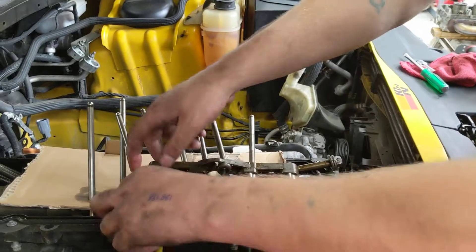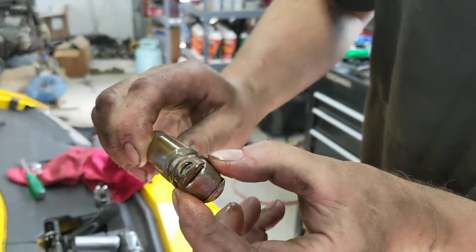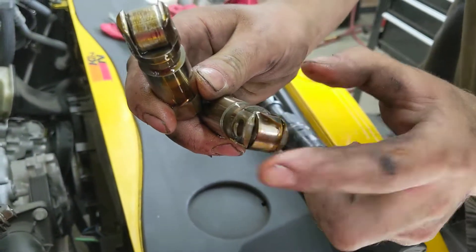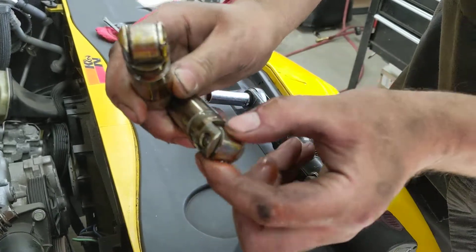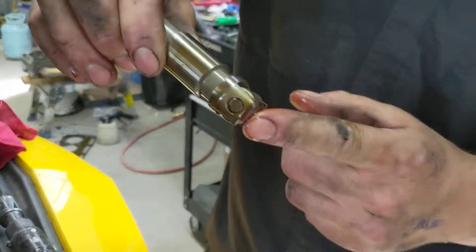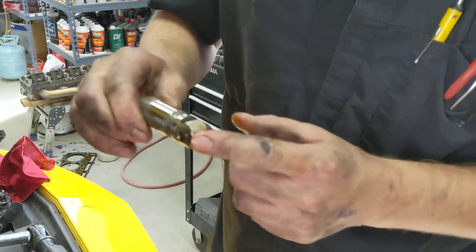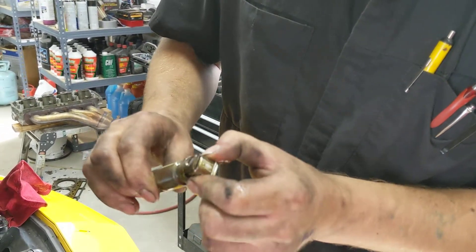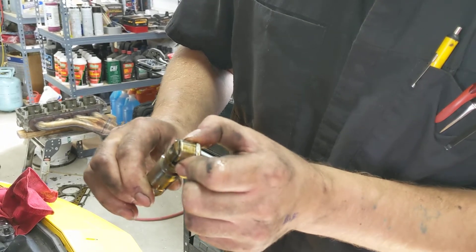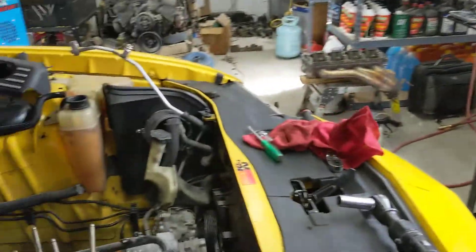Another good reason to do your oil changes sooner than later is these lifters — as you can see, this roller on this lifter is completely seized. This guy rolls; that bearing moves nice and smoothly in there, got oil to lubricate it. And then you got this guy completely locked solid. What happens is these bearings fail over time, usually due to extended oil changes and inaccurate lubrication and heat. When this bearing fails, this roller on the lifter locks up solid, and then it grinds away the lobe on your camshaft. Then you got to pull the whole engine apart and do everything.